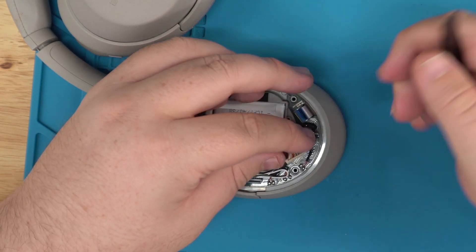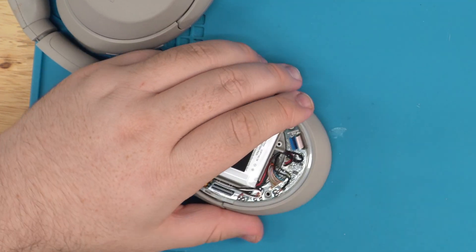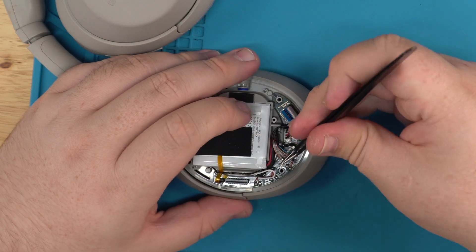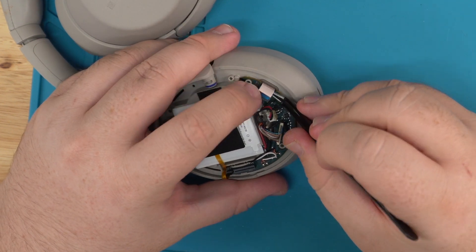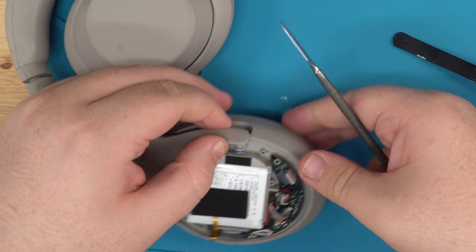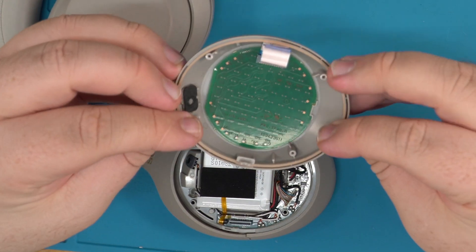Grab your main clip, bend the wires a little bit. When you place it in, don't just squeeze it — make sure it's fully in there and nothing's in the way. Go from each side, one side of the clip to the other, and at the same time press down. If you're pressing down and one side goes in but the other side doesn't, you might have already broken the clip. Place the wire underneath there. These wires are sticking up a little bit but that's okay, as long as they're not sticking up over this. When the cup goes down it'll just snugly push them down. Grab your charger port, put that in — make sure you barely see the black line out and you know it's all the way in. You still got this side to put in. Use the pry tool or slightly put some pressure on it, get it down, and slide in — it clips in by itself. Pretty flexible, never had one break on me yet.